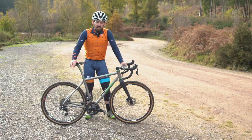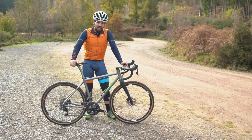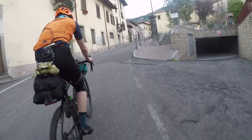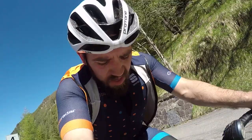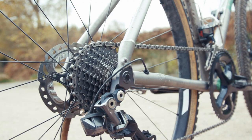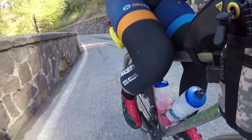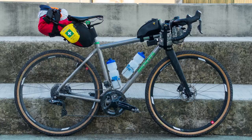This current spec is pretty much how I had it for the Jeroboam 300 that I rode with Jack — if you haven't seen those adventures, click the link in the video description. One thing we noticed from the Jeroboam 300 is that fully loaded gravel bikes are very heavy — just absolutely dying for an easier gear. The gearing on this is a compact 50-34 with an 11-30 cassette at the back, and that 30 was quite welcome during the Jeroboam because we had extended climbs. The longest climb was close to two hours on a bike that probably weighed about 13-14 kilos fully loaded.